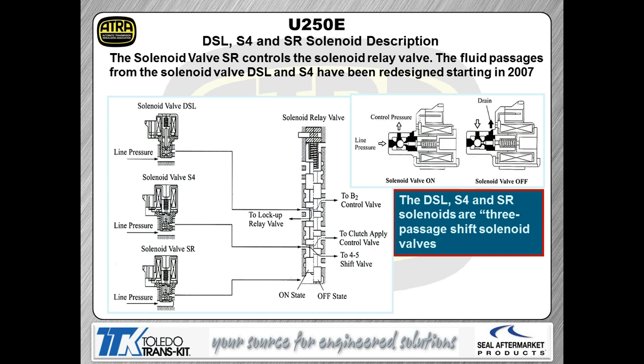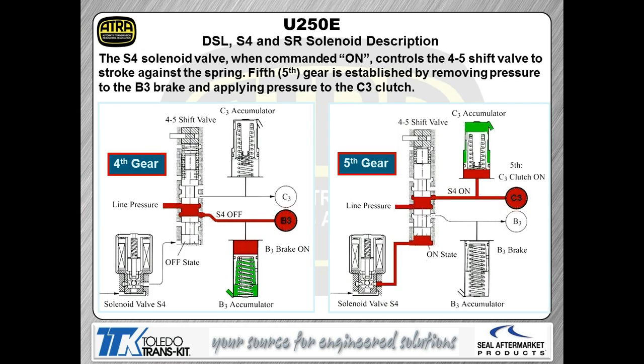They've got them in this transmission also. Again, so you can control pressure a couple of different ways here. We're going to take a look at a typical shift valve and how that would actually function. In this instance, they're using the solenoid and the shift valve as a shuttle valve train to shuttle the oil pressure between 2 different clutches.